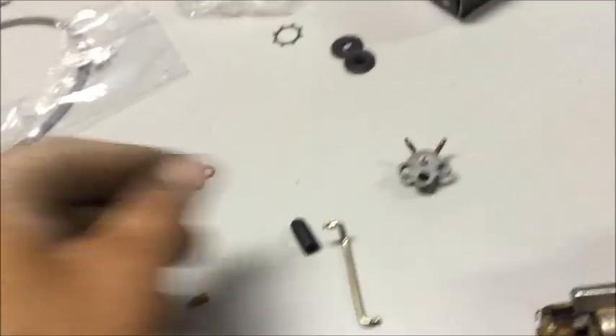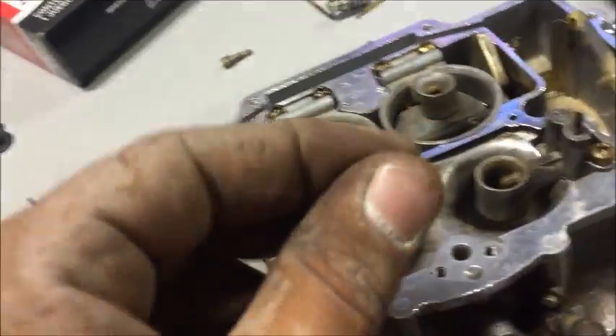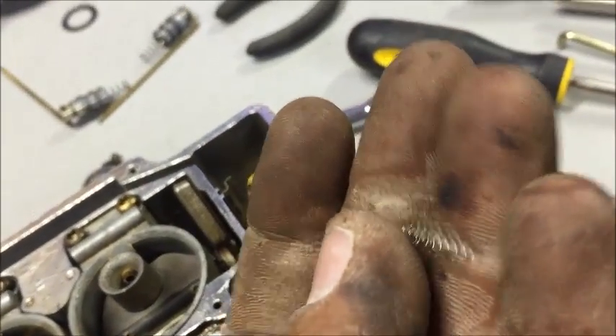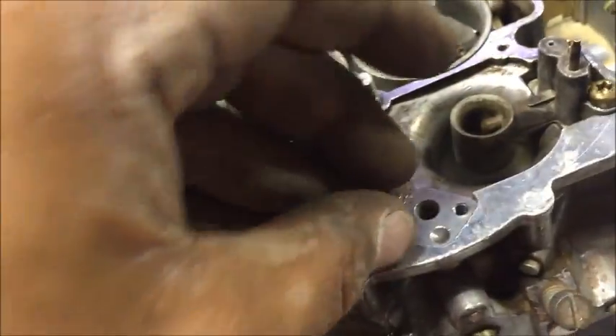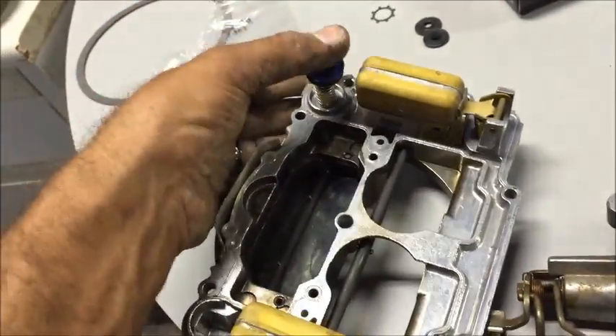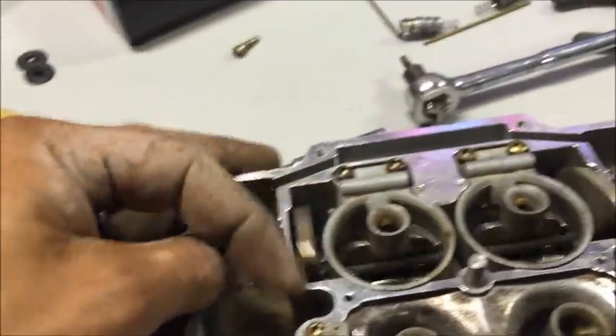Now you've got that jet cleaned. Find your right gasket. The important part here is the weight — the weight needs to go back down inside there. The new one is going to go back down inside there before you put this back on, and there should be a spring for that. There are two sides to the spring — one is small and one is big. The small one goes down. Then we're going to put this on top of it and tighten it down. Now we're ready to stick the top on. Your accelerator pump can just sit in there and then lower it all in one shot. Slide plates — we didn't worry about pulling them out because they were clean. I think we are ready to set the top on.